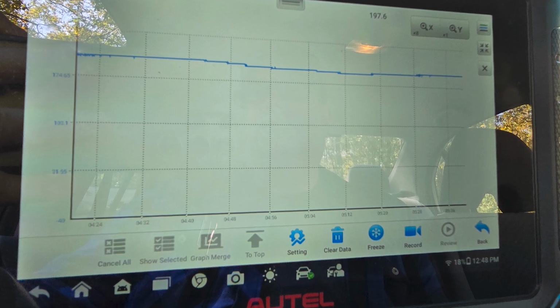This car runs great, can't get it to overheat at all, but then eventually after a while it'll finally overheat. What it's doing is over-pressurizing the cooling system, and it's actually blowing coolant out through the overflow bottle, and then by the time it cools off, it sucks some of it back in. Everything seems fine when you look at it if you're not paying close enough attention and looking at the state of that bottle after a drive.